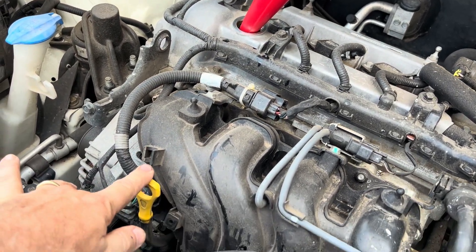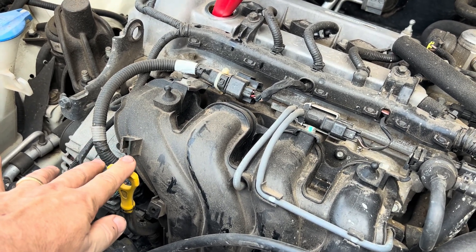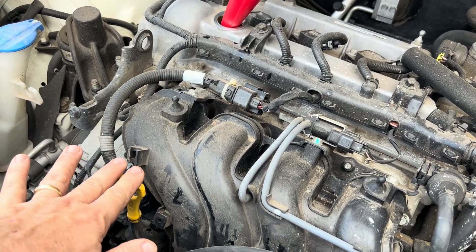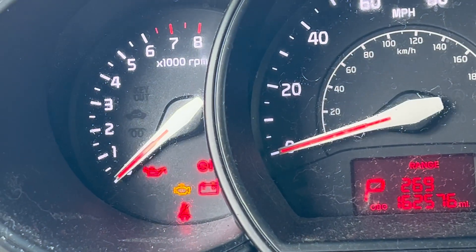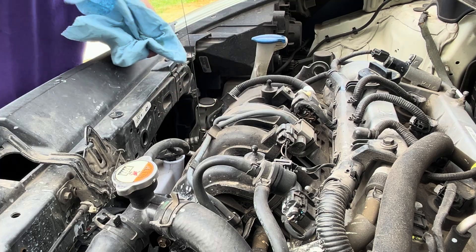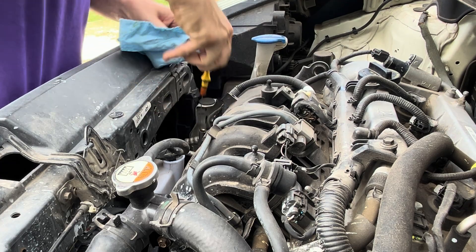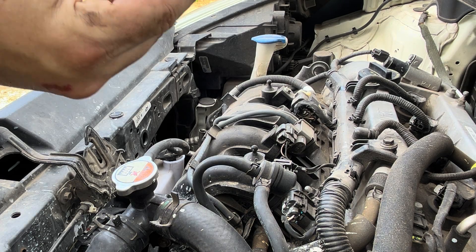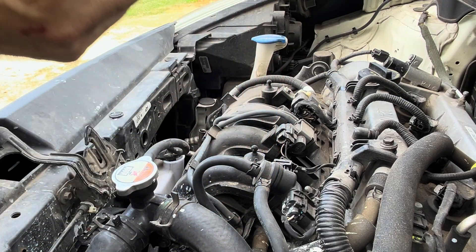Normally the next step is to check the engine oil level with the dipstick, but remember I did not pre-fill the oil filter so that needs to get filled. We're going to start the engine — as soon as the oil light goes off we know the filter is full. Then shut the engine off, wait just a minute for any oil that was pumped up to drain back down into the oil pan, and then check it. As you saw, that filter fills up really fast — just a few seconds. I'll wipe off the dipstick, reinsert it, make sure it's seated all the way down, and check the oil. That is perfect — it's right on the full line.